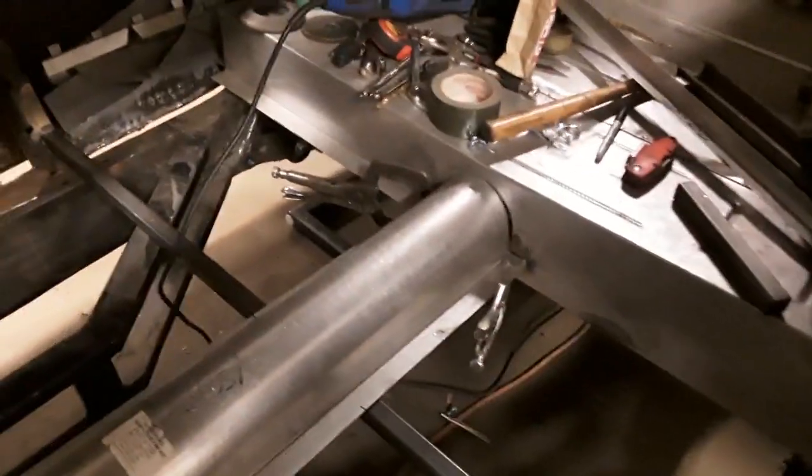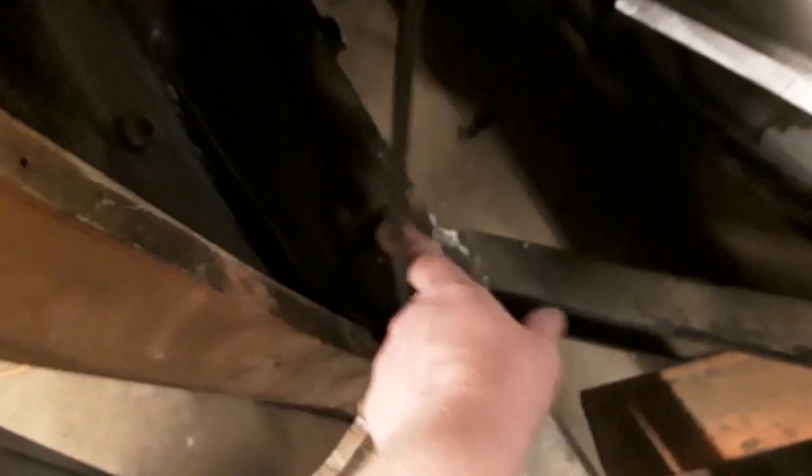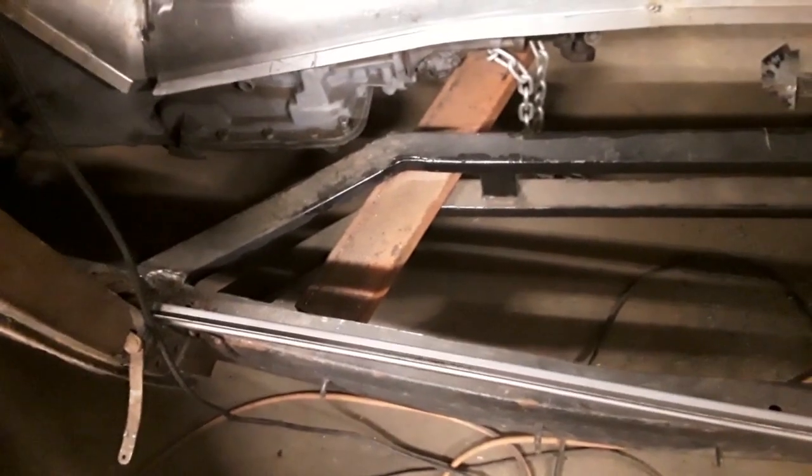Continuing on with the floor, what I've decided to do is build a framework all along the perimeter of one-by-one tubing — one-square tubing — and then weld it into the body wherever I need to do that. I'll have a couple of cross braces going across underneath where the seat's going to go. I'm going to start by putting a piece under here, then welding it to this brace I've already put in. The next step would be up front here, going across, finding somewhere to weld to in there, which if you look on the other side might be a challenge — and then coming along the edge of the frame rail.